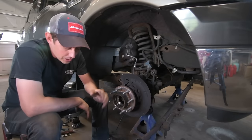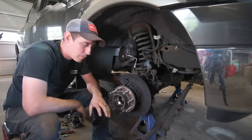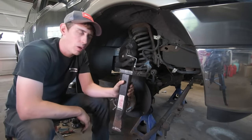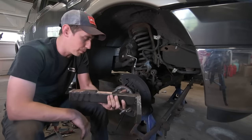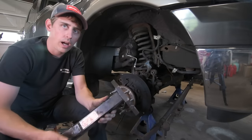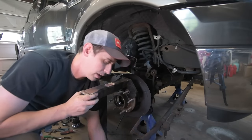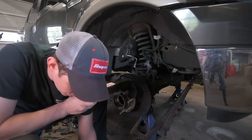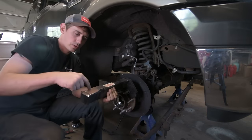One of them, this is what I found has been the easiest way, but it does sometimes risk damaging the bearing only because of the way that it works. But this tool from ATD, I'll put a link in the description. This is awesome if you're trying to take a wheel bearing out to change it, or, you know, ball joints or even a U-joint job like this. So how it works is you put it on the studs, and then it comes with this kit with all different size nuts to fit different applications. And what you do is you thread these nuts on, and then you smash right here with a hammer.